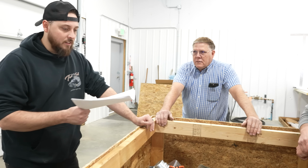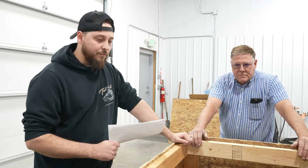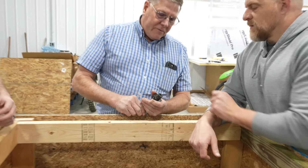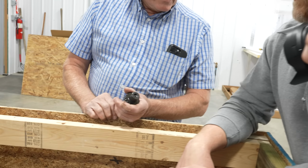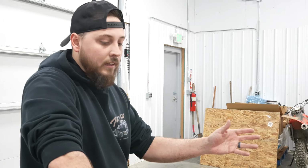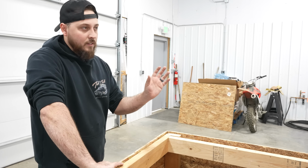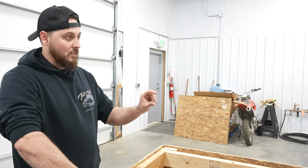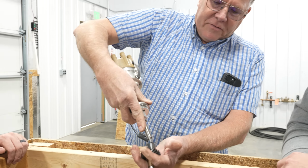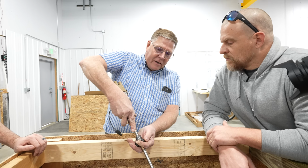So, with that, let's talk a little bit about running it on the dyno, because we did take it over. On that first day, do you have that intermediate shaft anywhere? Right in here. This piece. That slot was too wide this way. It would run fine at 1,000 RPM. It would idle great, but as soon as you brought the RPM up and tried to hold 4,000 RPM, some kind of harmonic was hitting with that slop in there, and the timing was bouncing all around. This isn't the one that was bad, but it just had way too much rotation this way. They did not fit well together.